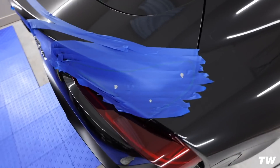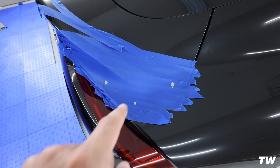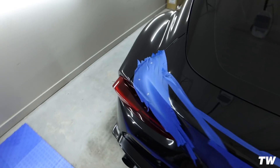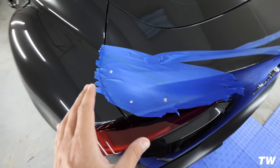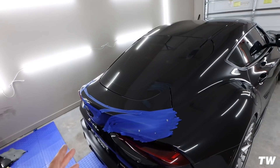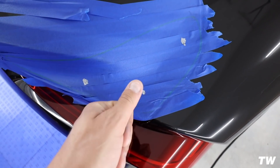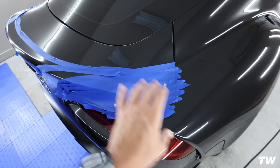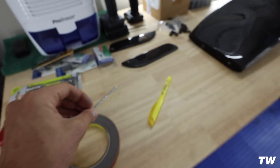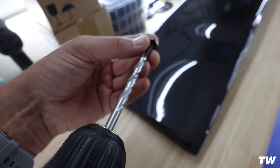When drilling and making these line up with the holes it's going to be tough - it's not going to be perfect. Just be prepared to open things up a little bit and use some adjustability to make everything come together. You want to make sure everything looks even on each side. The scary part about drilling into your trunk - one shot. Honestly if I ever decided I wasn't going to run the wing again, I'd just make two little paint-matched pieces to cover the holes. Now is the time to start drilling - start with the smaller bit, open her up to the larger one.